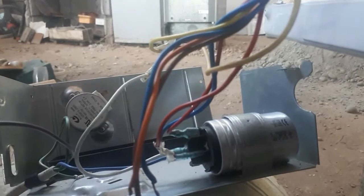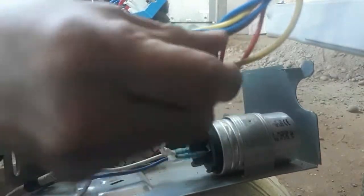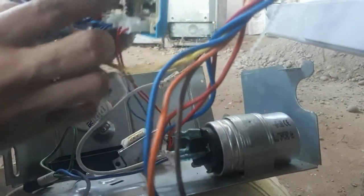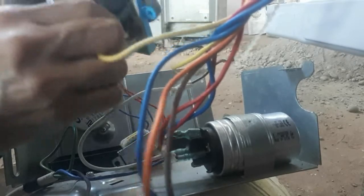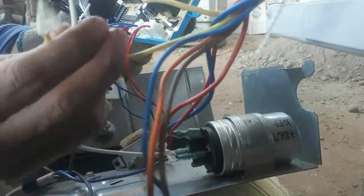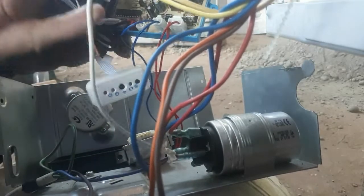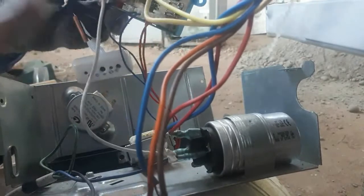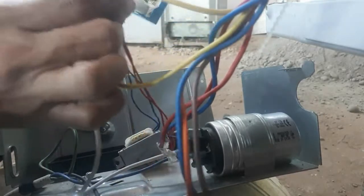The brown and blue wires come from the AC cord. Now on this board, since we've already assembled it, there are indicators labeled. The yellow wire goes to the compressor — you can see the 'compressor' label on the board. I've already joined the neutrals together. One goes to the compressor, one goes to the dual capacitor. The neutral from the board goes to the capacitor — connect it to the neutral terminal. The brown live wire connects on the other side as the line.